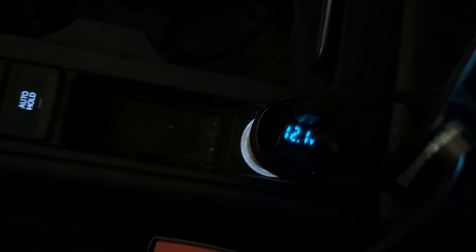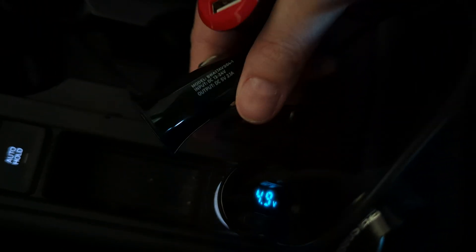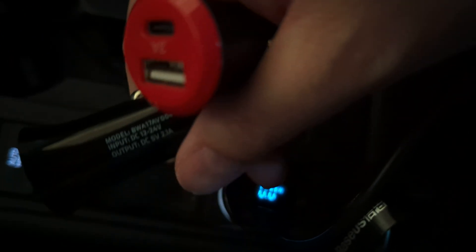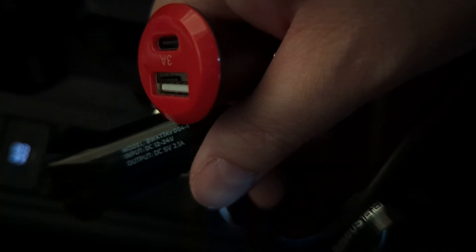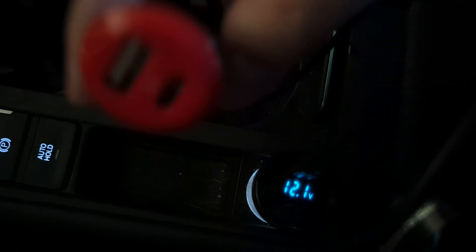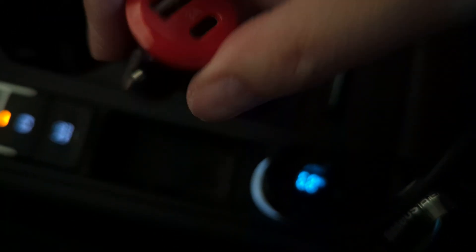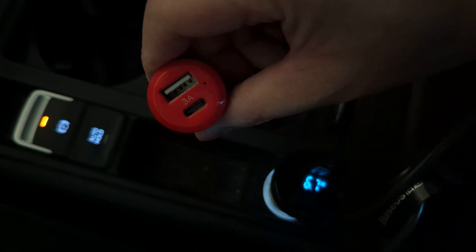The reason why I bought this was because I have all these other chargers and they charge really slow, which I don't mind — I actually like it because when I'm on a long drive, I don't really want to kill my battery by charging too fast because it will make my phone hotter. Here's one that's a no-name brand — as you can see, it's very low: 5 volts, 2.1 amps. That's it, nothing special. And then this one was my first USB-C charger — it says 3 amps, I'm guessing only at 5 volts though. It's faded. So it can only do up to about 15 watts.